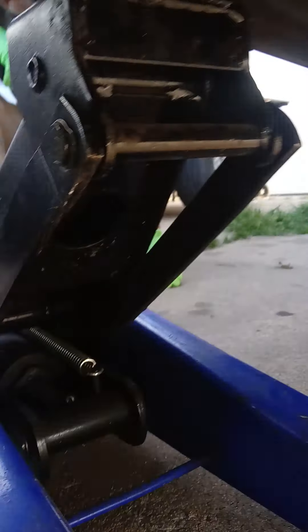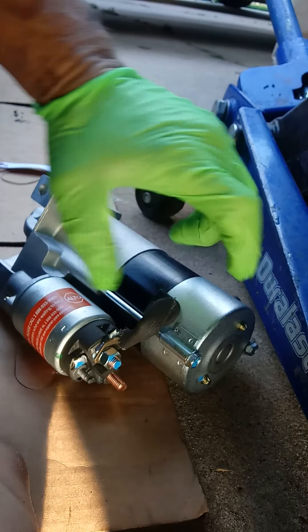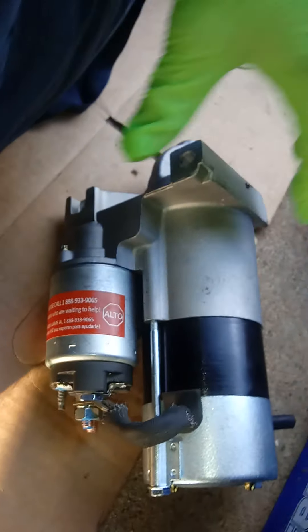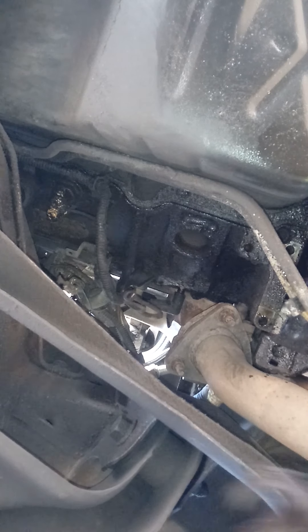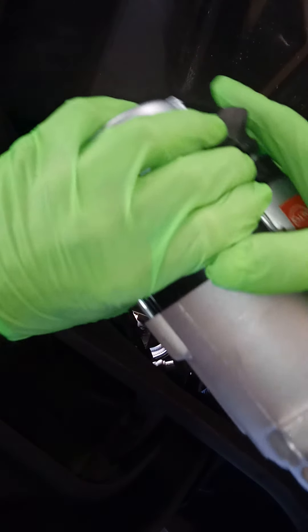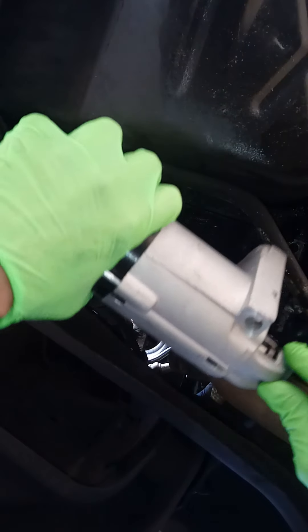As far as the new starter goes, go ahead and take that little nut off and that other nut off so it's ready. Just slide this back in the way you took it out into the hole, make sure it's facing the teeth. Get a bolt started in one of these holes. It's got to face this way — pop it in, then go straight up and get these bolts lined up.